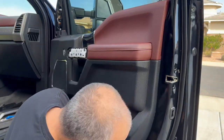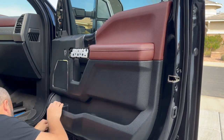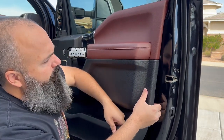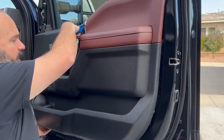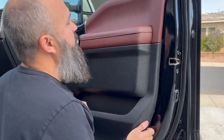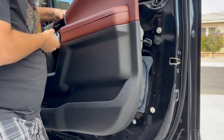Now we can move on to popping the door panel off. Use our trim tool to pry the plastic clips back, and once you can get your fingers under there you can work your way up. Then we're going to have to disconnect our handle and get up and over our lock mechanism, plus our lock switch and our window switch — clip at the top. Always try not to pull away too forcefully.